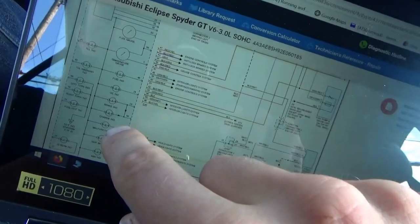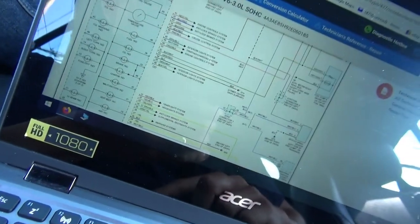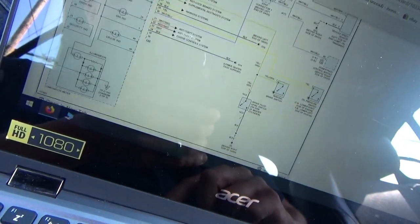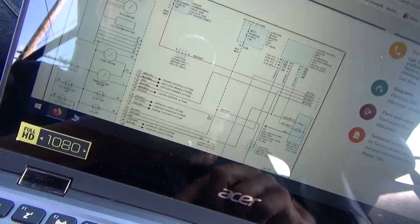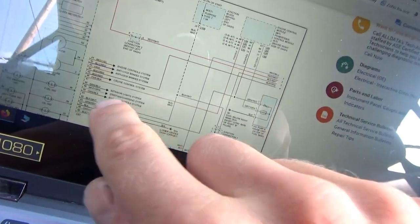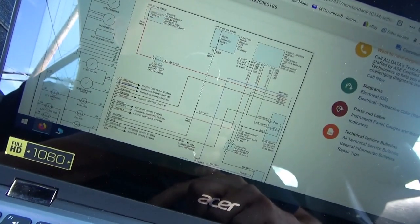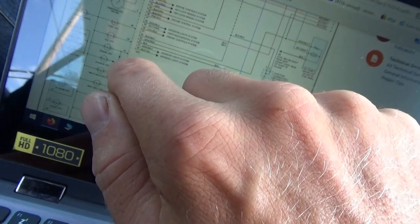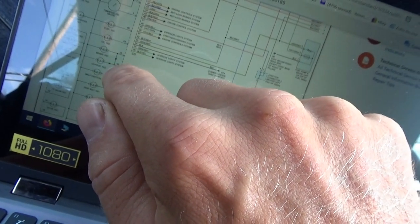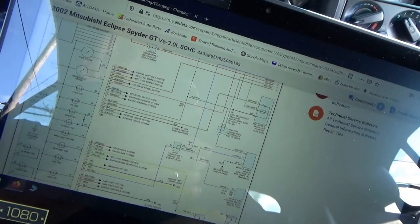So there's a diode between them. This is the power side of those bulbs — it's fed by fuse 52, a black and white multi-purpose fuse. The only way those bulbs could light at the same time is if the charge indicator bulb pin 49 is grounded. Pin 49 goes to our starting and charging system.